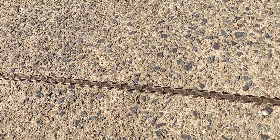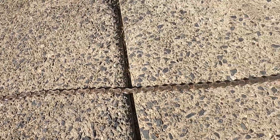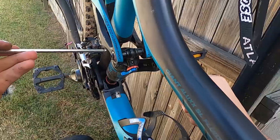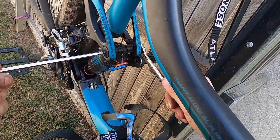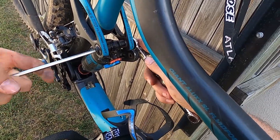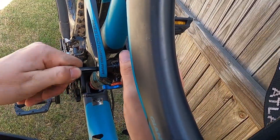Not that I don't trust the bike shop that built my bike, but for my own peace of mind, I'm not using my old chain as a reference length — I'm going to find the new chain length for myself. To do this, I have to remove the shock from the swingarm so that maximum length from the front and rear sprockets can be achieved.